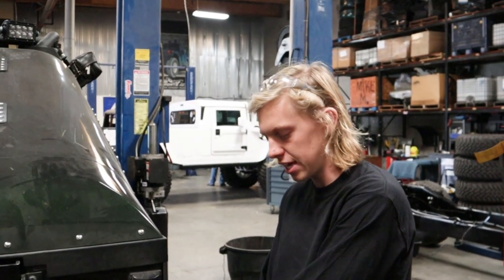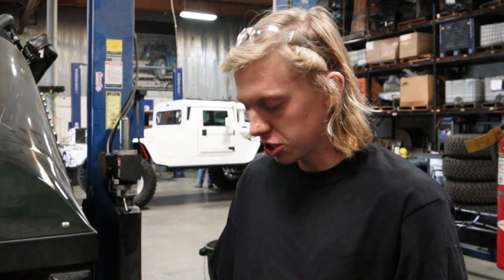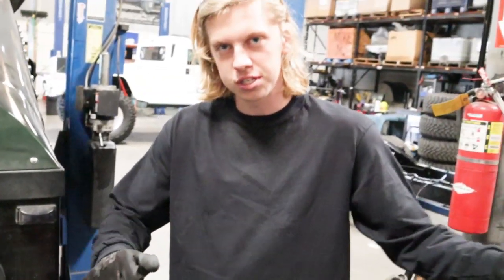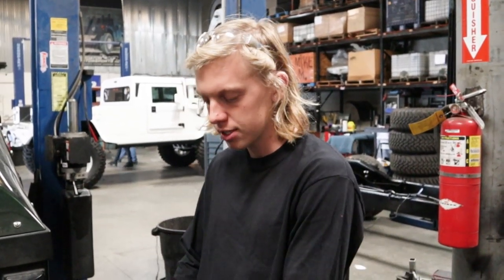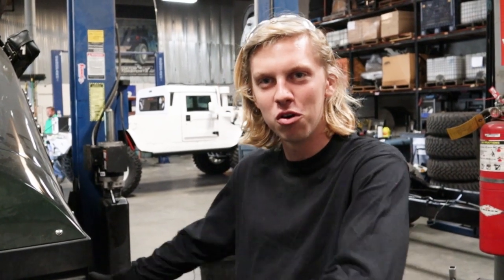So that's what this tab was for — it'll be for a little rubber bump stop that gets bolted to it. Just as an extra backup, because you do have the pin still that as it's opening will self-lock into the little thing to stop it from hitting the truck. It locks right as it hits the bump stop, so there's two things stopping it because it's an aluminum body.